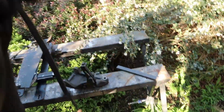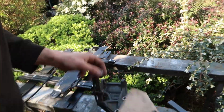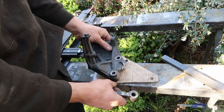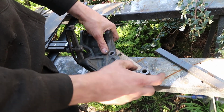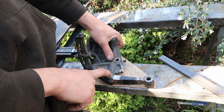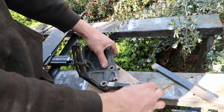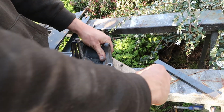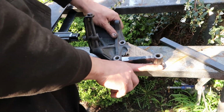What was your power steering bracket? So I put it in now, so basically that hole. I made a little template to get a rough idea of what we're doing, and that's the bottom line along the sump line, and you got your two bolt holes. So that bolt hole was there, that was the shape of the old bracket. I've cut that off. That's going to sit roughly like that, but we need to go to the car, bolt that one on, try and bolt that one on as well, and as soon as they're both bolted I might need to just grind this so I can get it to fit nice and tight with the two bolts in, and then I'll just tack it, take it off, weld it properly, and then that'll be in the exact right place. And then I've got to cut this one off because I know that's an exact 90-degree angle off of there.